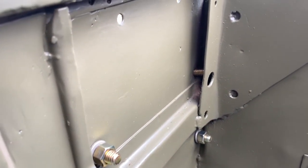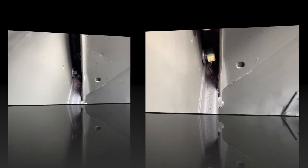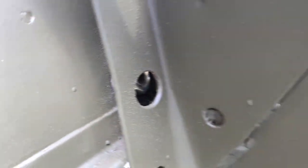There's a brace on the tub right where that bolt comes through the back side, as you can see here. I've got this bolt all the way inserted, so I'm going to slide it out about halfway — just a little bit poking through — just enough to hang the lock washer on. You can get your hand in there pretty easily and get the nut started just by finger. It is possible to do without a wrench, and once you get it started, you can get a wrench inside there to actually tighten the bolt.